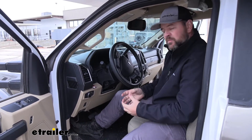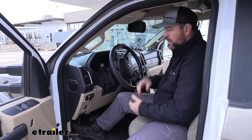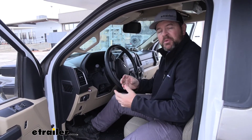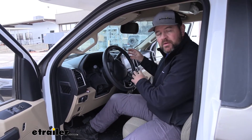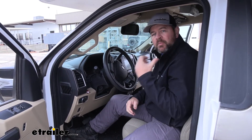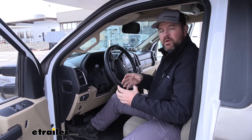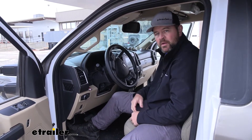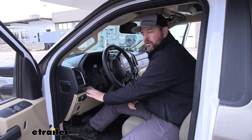If you don't have a brake controller, sometimes you'll have a factory plug for a factory tow package somewhere up under the dash. There is a kit for a brake controller that you can buy — it's just a plug, and you would basically use one of the wires off of that, plug it into the factory plug, use the blue wire off it, run it through here, and it would go directly back to the back of the RV to the seven-pole plug. If you don't have a factory tow package, your kit is going to come with a bundle of black wire that you're going to tie into the back of the light and run it back to the seven-pole plug and attach it there, so that the signal coming from the car runs through that wire up to this light.